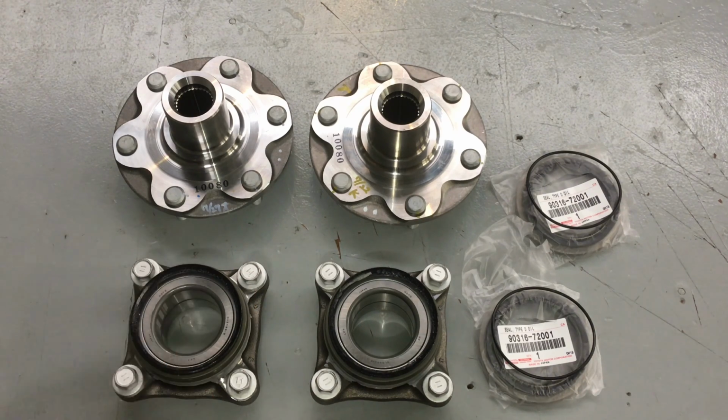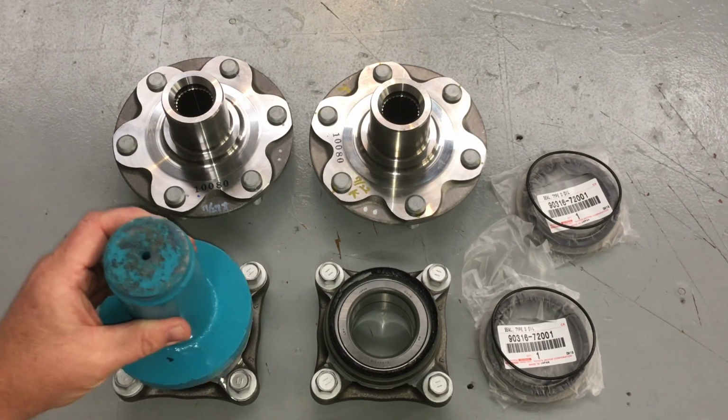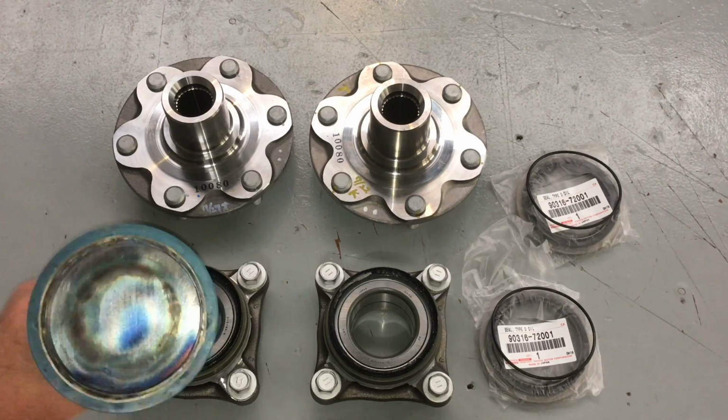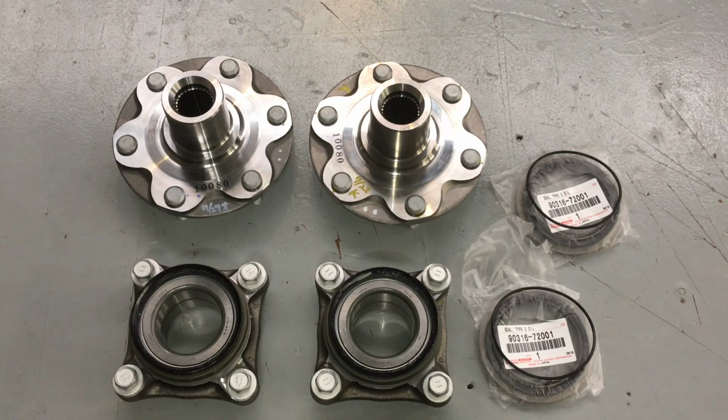Now there's a number of different seals, genuine, aftermarket, even Toyota use different brands of seals in their genuine line. So we've nutted out the ones we like best, the part numbers we like best, to get the brands right, or buying those brands direct from those manufacturers, OEM suppliers, to put this kit together for you. So I've professionally pressed those on. We've got a special tool for that. You can either use a press or you can tap it on with a hammer, nice and square. It's custom made. Check that thing out, right? Anyway, so they're on.